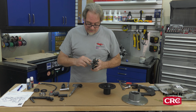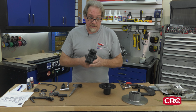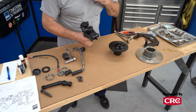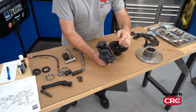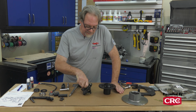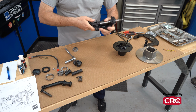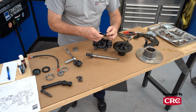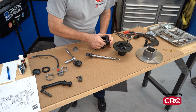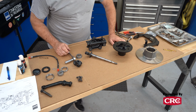Another thing we should mention that I forgot when we were going through the analysis of the suspension is this is a hardened axle. This is not what a Sprite came with, but this is a very good idea if you're doing anything but a car show. And you can tell one of these modified axles because it's got welds back here, whereas on a stock Sprite it's just pressed in. So a Sprite uses a kingpin system, which is very antiquated. But to give you a rough idea what that looks like, it has this rod, the actual upright. You're going to want to grease this, which we'll do here momentarily. It's got these odd little tubes that act kind of like a toilet paper holder. And you put it in one side and then press it in.